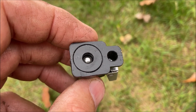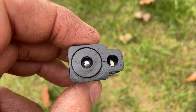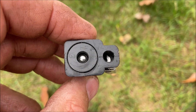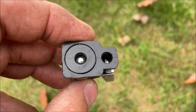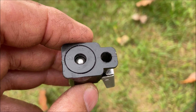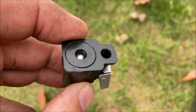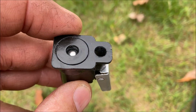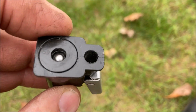So when I initially had a leakage issue, I was going to take a little piece of cork and make a washer and put it on there. I thought, hey, it's a 40-year-old motor. Maybe that face is just corroded or pitted or whatever. But my thought was wrong. The face here really doesn't matter. It's all about that O-ring grabbing the outside diameter of that brass shaft that comes off of the motor itself.